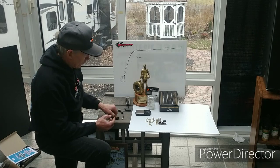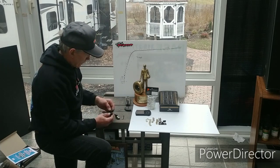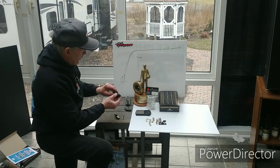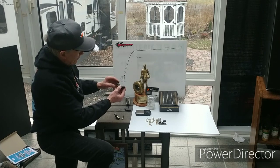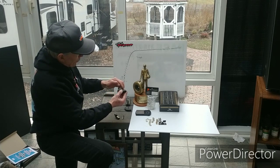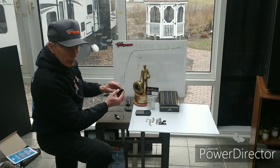The beauty of the Thundership: I set it up the same weight. I looked at the profile and figured I was pretty smart on clutching, but I learned something. The stock weight is heavier here in the belly, and about the same on the tip.